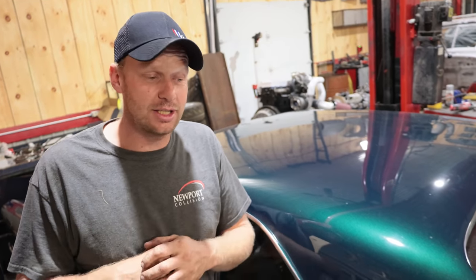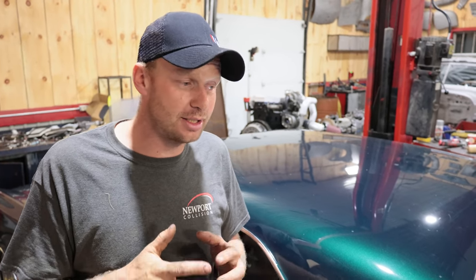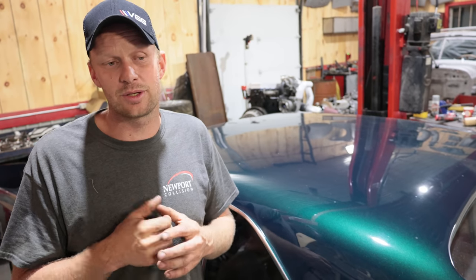One little mistake, and that's why we're here. We make mistakes. I took the TPS signal off the sniper. Can't do that. Once you share it, I got it working, no problem. Once I adjusted the TPS a little bit, it worked for a bit, but then if you tromp on it, it kicks out the transmission because the sniper likes to dominate that TPS signal.